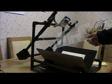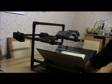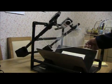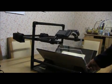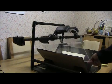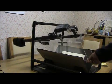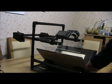One of the key features of this scanner is that it moves up and down like a teeter-totter or a seesaw. As it moves down, the platen is flexible and able to fit right into the groove of the book. There are two cameras which move up and down with the plexiglass so they're always in the exact right position in relation to the page.